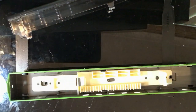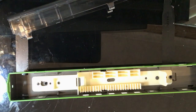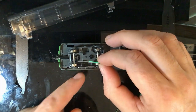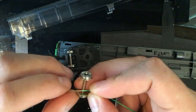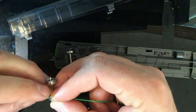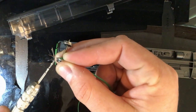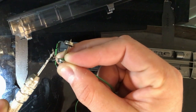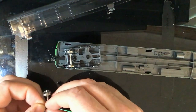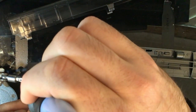I'm just using printer wire - it comes in strands like this and I just pull off what I need. I find it's nice, thin, and cheap. This section gets tied onto one of these wipers and then we just pull it out a little bit and drop it down. I'm going to put a little bit of solder on the bottom and cut that little section off - I don't want solder on that because I'm still going to wrap it around the opposite wiper.